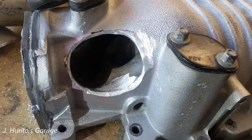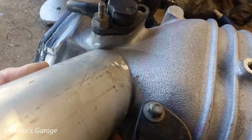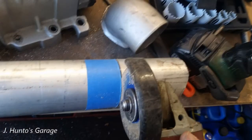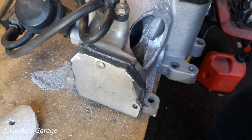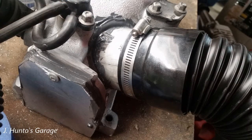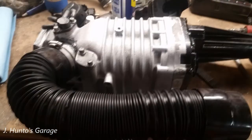The whole job took maybe 20 minutes to an hour or so, but got it done. Then I had to shape the pipe in order to get it to sit flush on the supercharger, cut it down to size, and then added the block-off plate on the back with JB Weld as an extra gasket surface, and went ahead and mocked this up in the back too. Again, you'll never see it, and it's under negative pressure, so I don't think it'll be an issue.